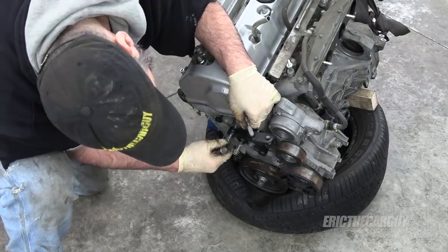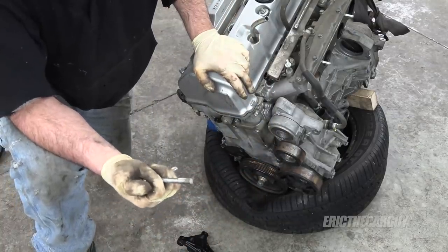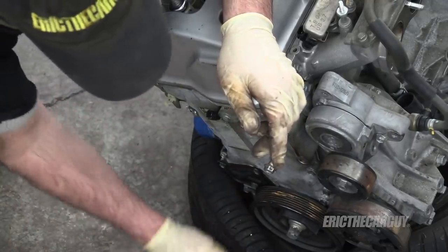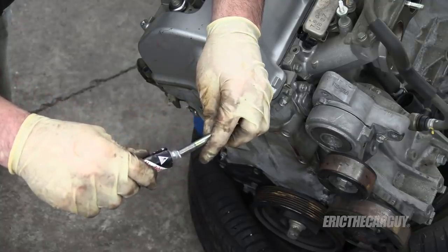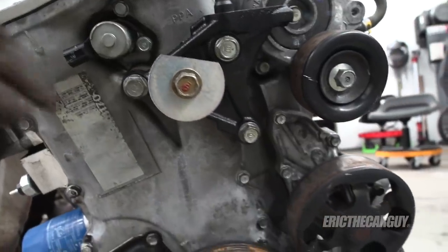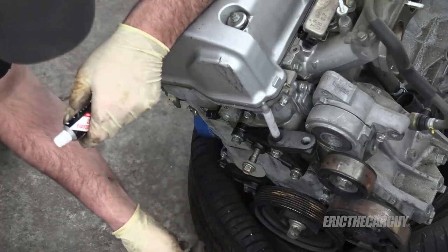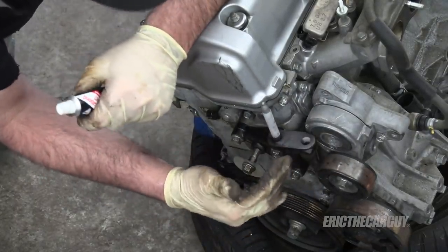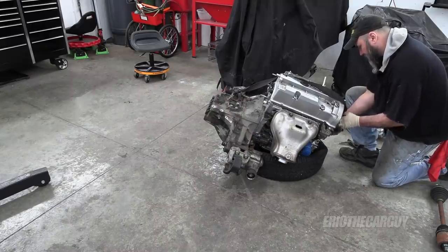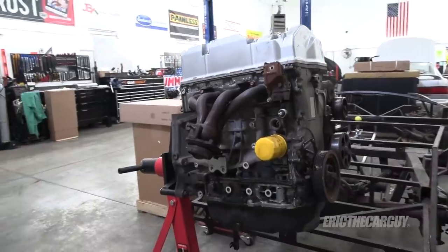I've kind of gone off the deep end here. And they appear to have Honda Bond on them, which says they might go into a water passage. I'm going to clean these up and get some fresh Honda Bond to install on them. Looks like the long one goes up in this corner because that one's raised up more than the others. I'm just going to add a little Honda Bond to the end of the bolt — it wasn't really on the threads, it was just more on the end. I've already taken the old engine and put that on the engine stand so I can do the autopsy at some point.